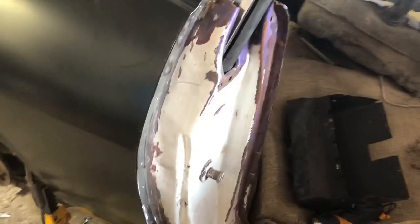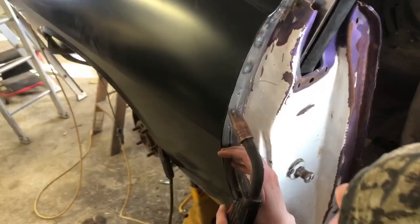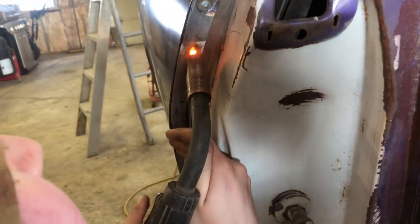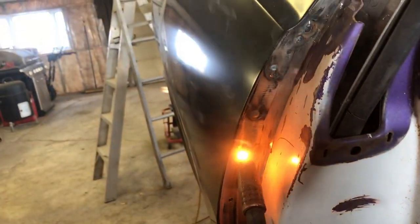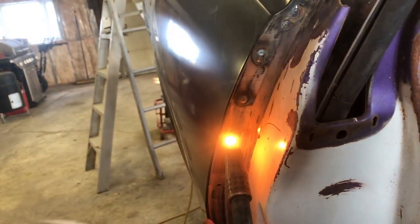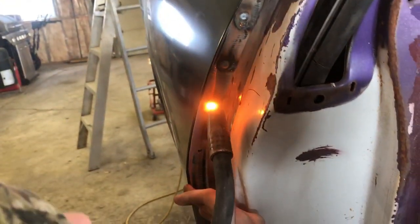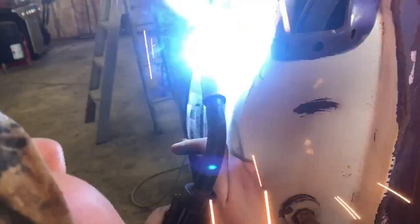Using lead is an art — not many people can do it, but I'd love to try it. She's going to fill up that hole where it burnt through. We'll weld it up in here and fill this seam with a little bit of sheet metal behind it to fill that gap afterwards. We'll get her running down the door jamb filling the plug welds we pre-drilled. You can see the drill holes in here — we'll just make sure it's secure to the door so the window doesn't shake and we don't get wind noise.